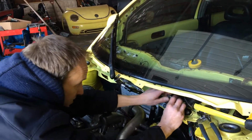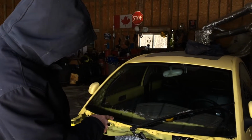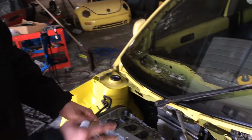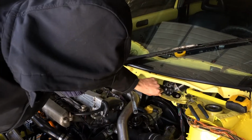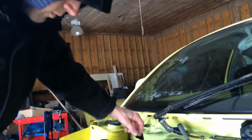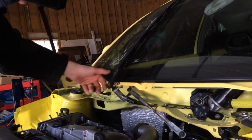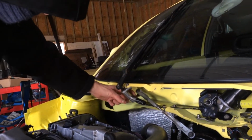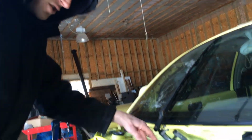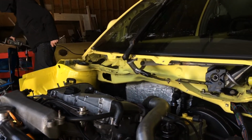So step one, let's cut this guy. Okay. Upon further inspection, it's probably going to be a little easier to leave this bracket as it is, because it's fine, it works 100%. We don't need to touch that side. This side we've already cut down and re-welded and need to clean up. So what I'm thinking is we'll cut this further up the arm here. We'll take everything off and pop the pin out here. We'll cut this further up the arm and take one of the longer factory arms off of the linkage that we stole this bracket from. Yeah, this guy here. Here, I'll go grab it and show you.